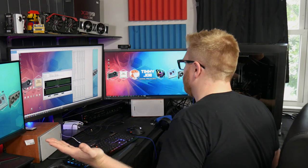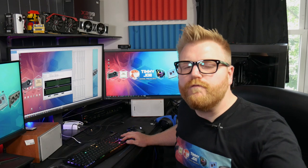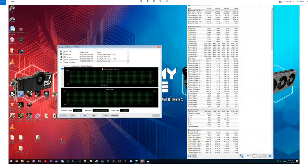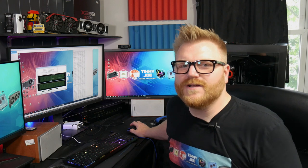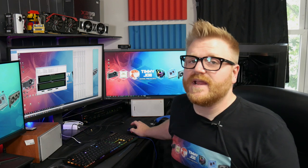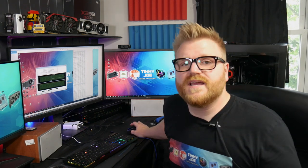The 240 was in a push-pull configuration. My case has RGB Intermax fans on the front that aren't on the same PWM header, so the cooler's own fans are on the CPU header running an aggressive fan curve. Switching over to the 360, the average temperature drops by about 4 degrees, getting close to 67°C during that part of the test — a decent temperature improvement just from upping the radiator size.